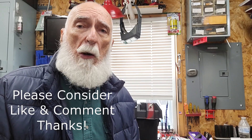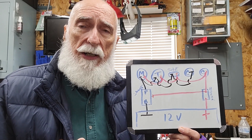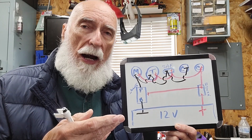Hey everybody, it's John from Oman Outdoors. In the last video I put up concerning a power management system for a small boat — a bass raider, plastic boat, or virtually any boat that does not have a built-in power supply — this is a self-contained unit in three different components. I had some questions about wiring it, so I'm going to put this diagram on the screen and talk through it. The most important thing to remember is red to red and black to black as you wire all your components together.